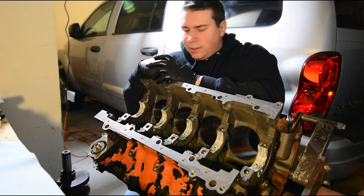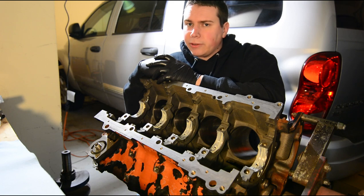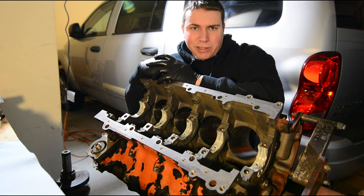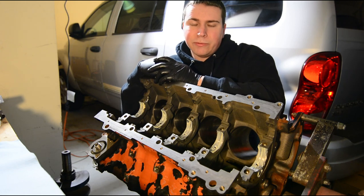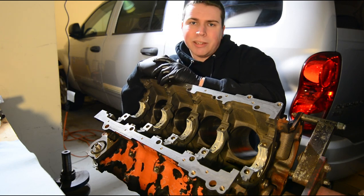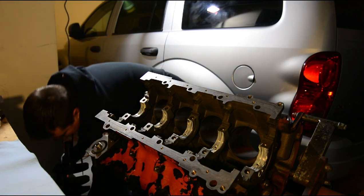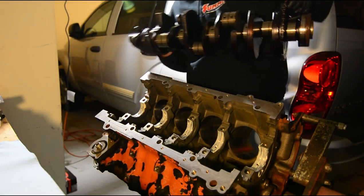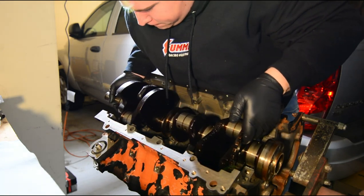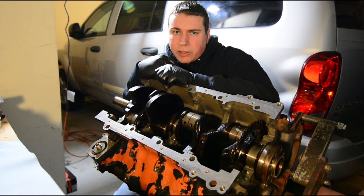Now it's time to install the crankshaft. This engine's been apart for a couple months, so another note: when you're storing a crankshaft, you don't want to store it on its side laying down. Somebody can knock it over, so if you can find a way to keep it strapped up, that's the best. Since it's so heavy, if you lay it on its side it can actually warp over time — and that's not good. Now that it's down in its hole, I can at least start putting the bearings in the main caps, and then we can start torquing it down.